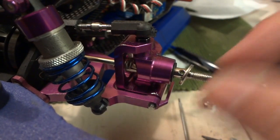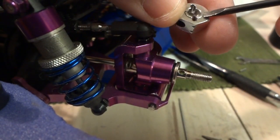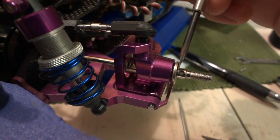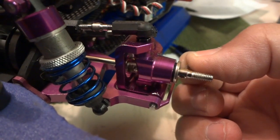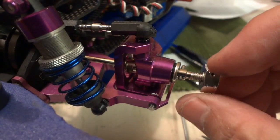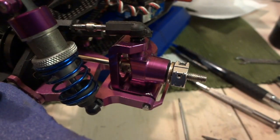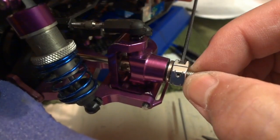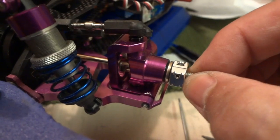Once I milled this piece — all the metal in here for the clearance — it's as smooth as it comes. I put this one and this one, and then my hex also has a little extra lip here, so this will just be enough to complete the remainder of the spacing. It works out really good. I put this in here, then put my hex in — fixed it. Now when I put this in I just go ahead and tighten it up and I'm ready to put on my tire. I'll do the same thing on the other side — nice and snug.